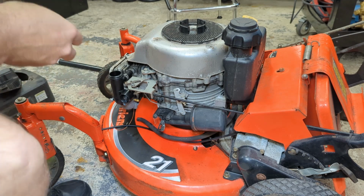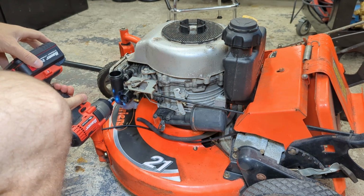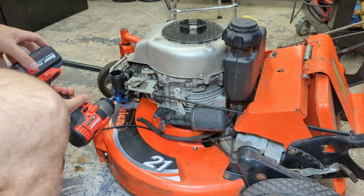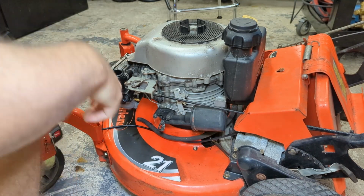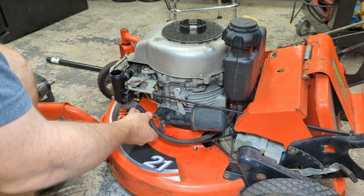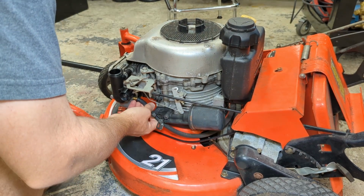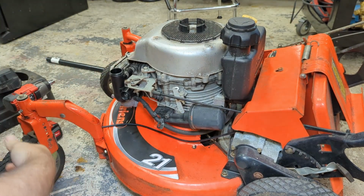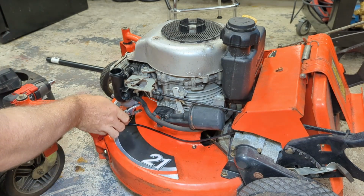Deliberately have not done the fuel line yet, because I want to add a shutoff valve for sanity, for me and for the next guy. Just who I am. Okay, that carb's not going anywhere. So let me hook up this end of the fuel line here. I did drain the tank out offline, so don't worry about that. We're not adding crappy gas back into this clean carb.